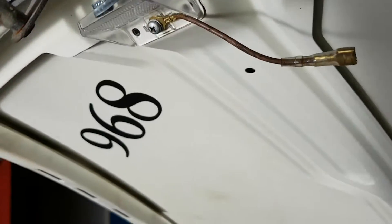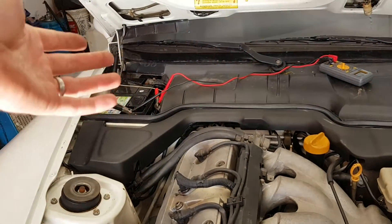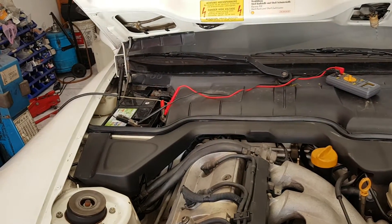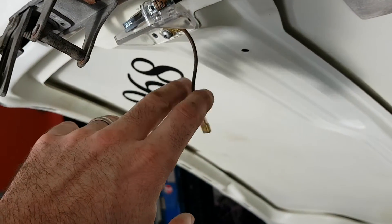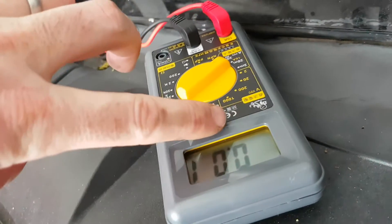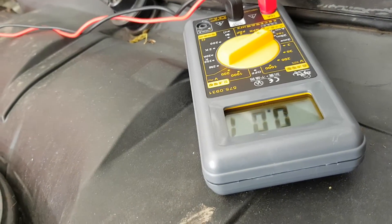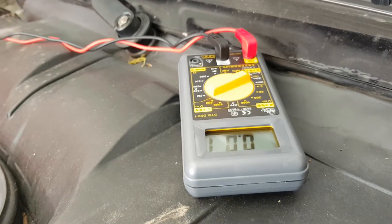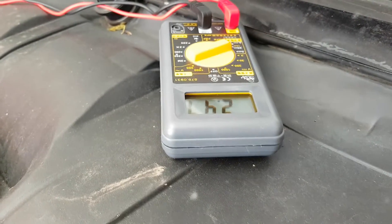I've bared the connections and taken the little plastic cover off to check them. What was interesting was the starter battery was draining and I couldn't figure out why. I'd run the parasitic drain test and not come up with anything — sometimes it would drain and other times it wouldn't. I've got the light connected up here, and you can see my multimeter testing the parasitic draw. It's 0.01, which is very good — anything up to 0.03 is good. However, sometimes it does change, let's see if I can make it do it now.